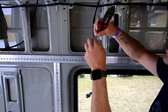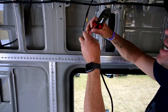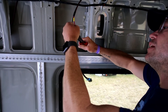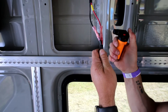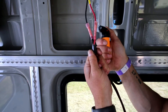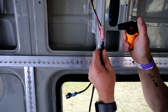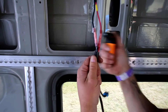What I'm making sure I'm not doing is jamming the wires in there. I want them all to fit smoothly inside the butt connector. If they're split and frayed going in, please straighten them out and make sure that they're all tucked into the butt connector nice and tight. Once you've crimped the ends, we'll go ahead and heat shrink — and again we're using the lighter, but I prefer a heat gun. It's just a much nicer way; you don't have to worry about burning anything, and it heats the glue nicely without overheating the wire.